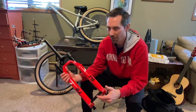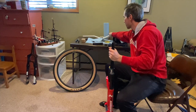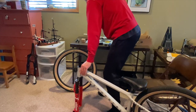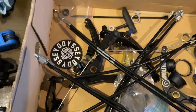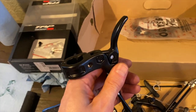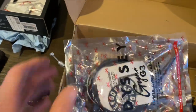Let's get this thing on the bike. I'll put a little grease down in the head tube — that keeps the fork from creaking. If you get that creaking sound, making sure it's well greased is usually the fix. We've got some old gyro parts here — the Odyssey gyro. We'll put that on and use this little trigger lever to keep the lever out of the way, since I'm used to riding without brakes.